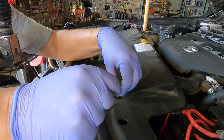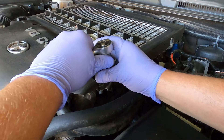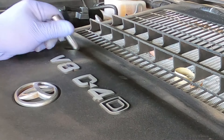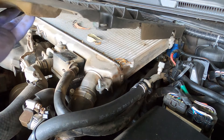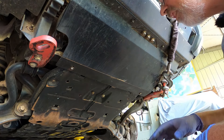Pull off the intercooler cover — it's got two 10-millimeter dome head nuts on it. My 10-millimeter socket isn't deep enough to fit over that dome so I use a long-series 10-mil. Once those two nuts are off, the cover lifts up on an angle, then pull towards the grille and off she comes. Next thing is to pull the bash plates off. I've got a combination of aftermarket — this is an ARB bash plate — and the factory bash plates, but they all have to come off.